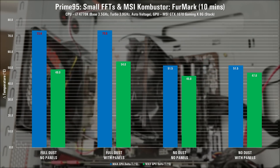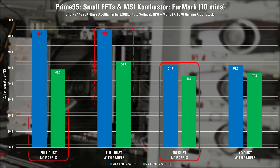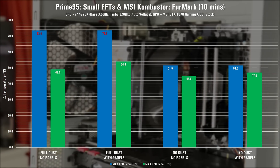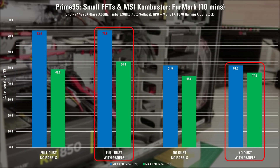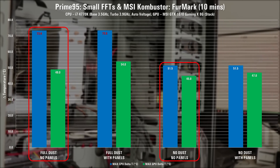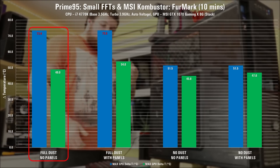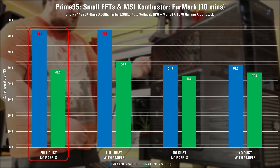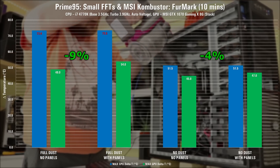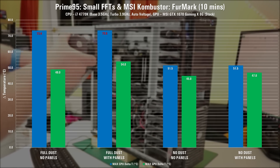Here are the final results. All temperatures are in degrees Celsius in delta T format. In terms of CPU temperatures, we're looking at a 20 degrees Celsius drop whichever way you look at it — clearly that clogged-up Hyper 212 EVO was really struggling for air. For GPU temperatures there wasn't a huge improvement, but since the GPU fins were oriented vertically with fans blowing upwards, far less dust gathered in the fin stack. Removing the side panels gave a 9% GPU thermal drop with a dusty case and a 4% drop in a clean case — so for the GPU it may buy extra time between cleanings. But for the CPU, no amount of side panel removal compensates for three years of dust build-up.